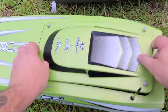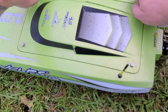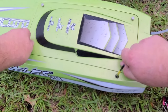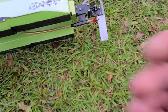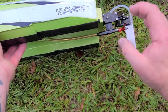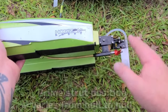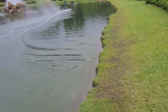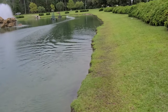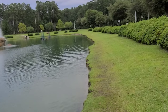With this strut position, if you're running a big prop — say you've got a 17, 16 like the stock prop on the boat and you want to run like an 18-15 or something, a bigger prop — you can go up with your strut and there'll be less propeller in the water. The boat's running with the strut higher, so there's less prop in the water, and you can run some big props with a high strut position. On the Blackjack 24, if you wanted to run the Velez prop, put the strut up higher than the ride pads and you can run a bigger prop.